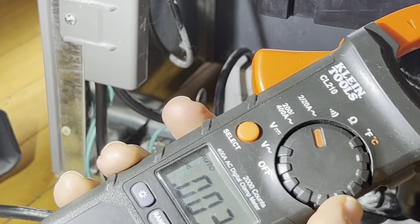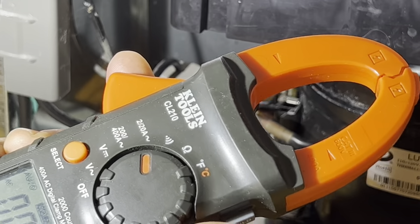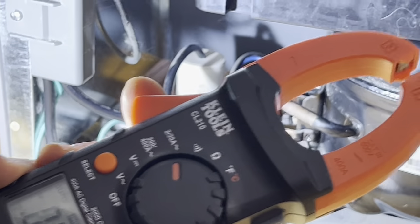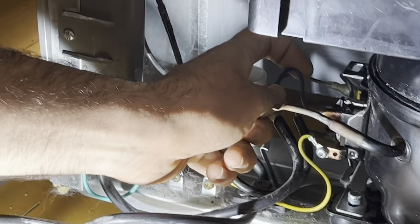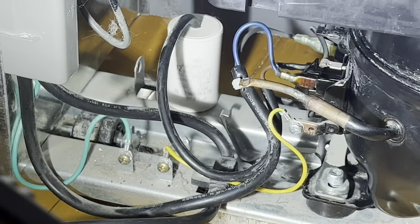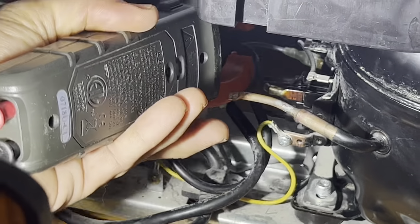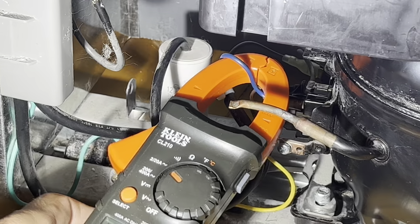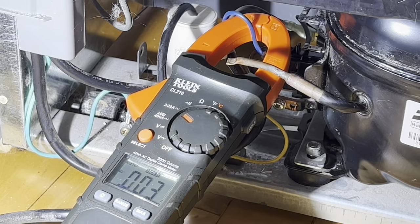You see this clamp on the multimeter — your multimeter needs to have this clamp, otherwise you cannot get the amperage reading. You open this clamp and set one of the wires in here. That blue wire that goes on the relay — I'm going to hold it inside of this clamp meter. You want to make sure it looks like that, and then you can plug in your fridge and it will show you the amperage reading.